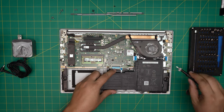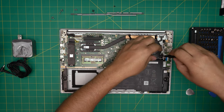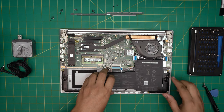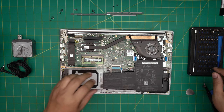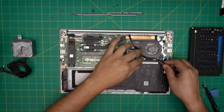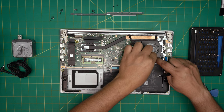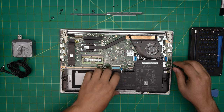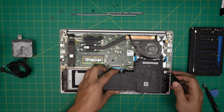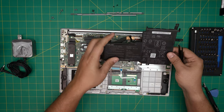Lift up the battery — there's one more screw by the fan that holds it. Now lift up the battery and grab a curved tweezer preferably. Remove the gaffer's tape from the wi-fi cable right there — you don't need to put it back on. Untangle the cables and remove your battery.